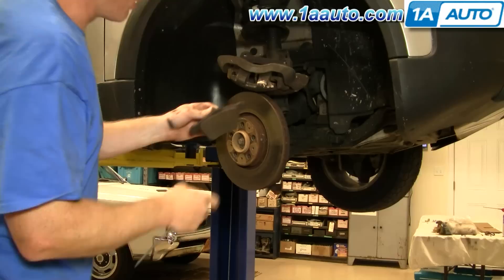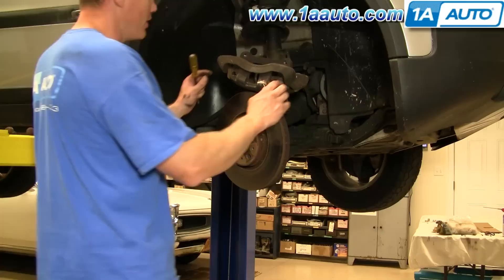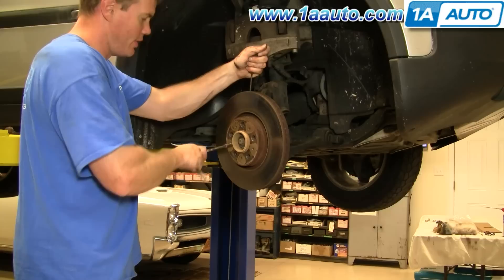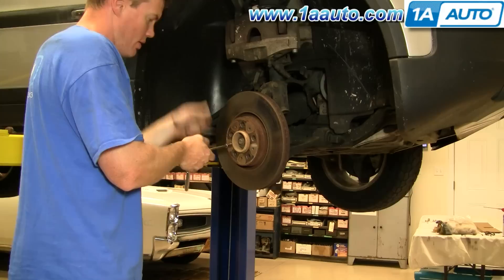You can see my pads are in good shape too, so I'm going to put this all back together as is — I'm just doing this to show you. Next thing I'll show you is how to remove the rotor. If you want to replace that, I just usually put the caliper right up there. You're going to find a 10 millimeter bolt on here. Just take a screwdriver to hold the rotor in place, and take that bolt off.